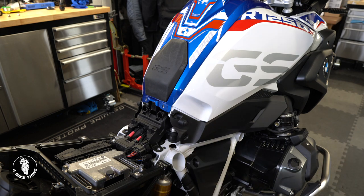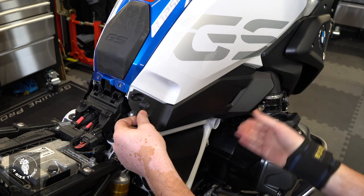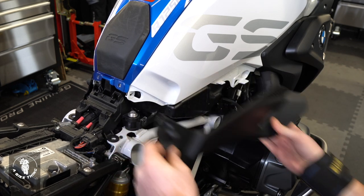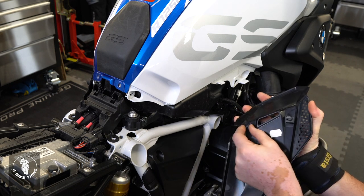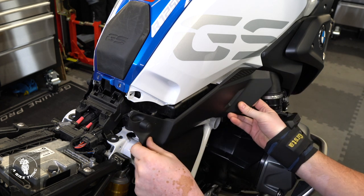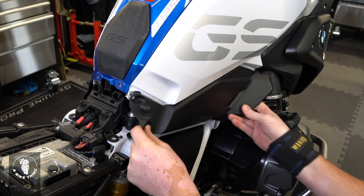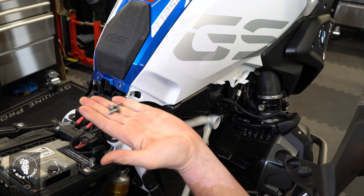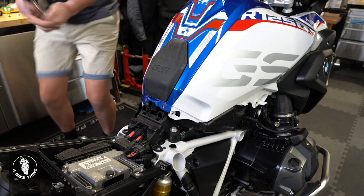With this panel here, what you do is literally slide it backwards. There are two screws and then you slide it back and it pops off — it's just these two tiny lugs that slide into slots. To put it back on, pop it over the top slightly backwards and then slide it forward until it clicks in, then those two long screws secure it.